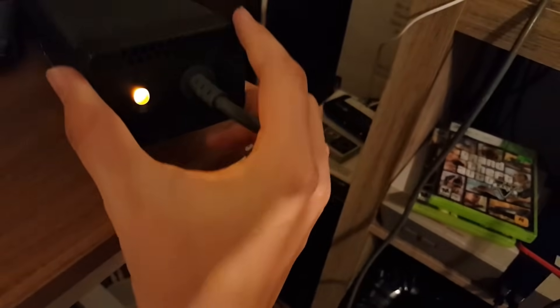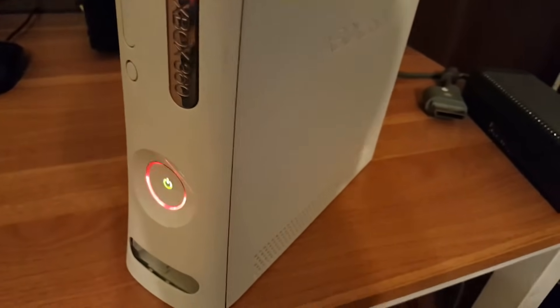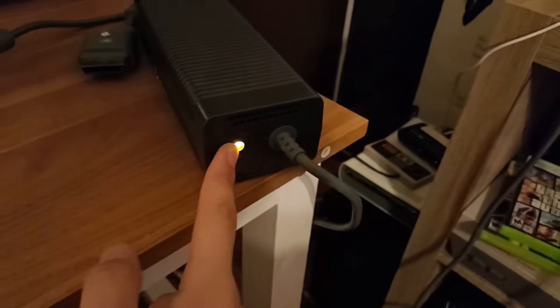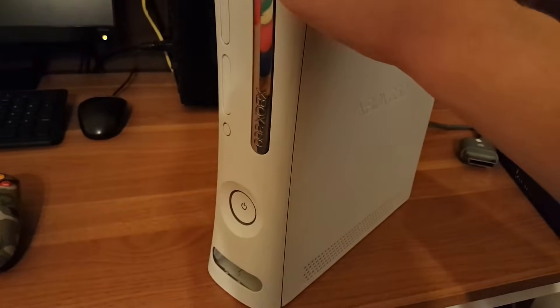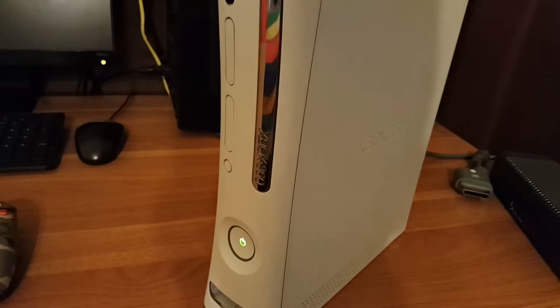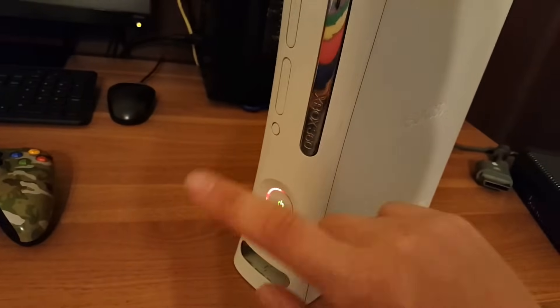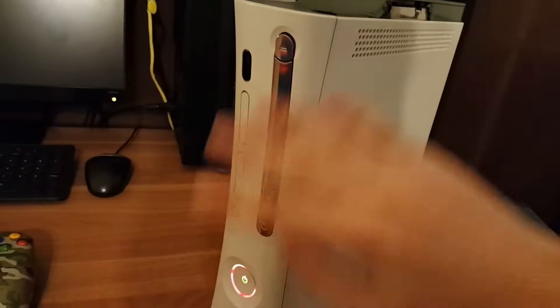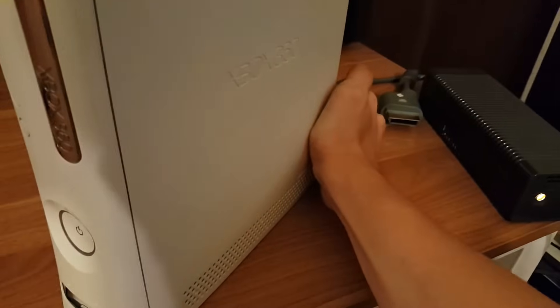When your console shows the red ring, you have to check this power box — if it is orange or red, it's the power supply. If it's green, that means it's the system itself. Regardless of whether the middle light is flashing or not, if this light is green it's your console; if it's orange or red, it's the power brick. Now, if the power brick is green and you still get the red ring of death, try this: open up your 360 — if it's a power supply issue, it cannot power the system enough to open the disc drive, so if the disc tray is stuck, it's power-related. Make sure your connections are plugged in all the way.